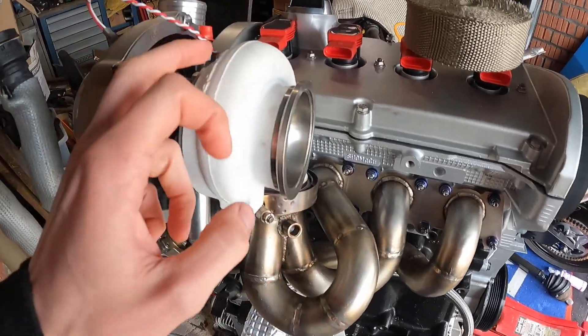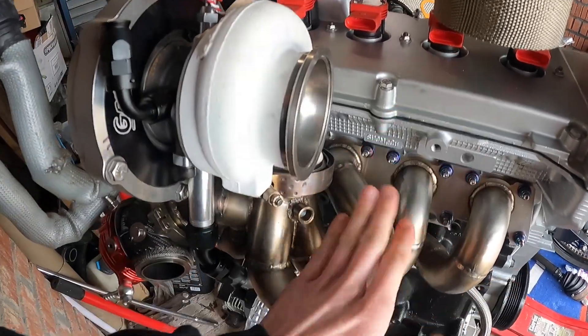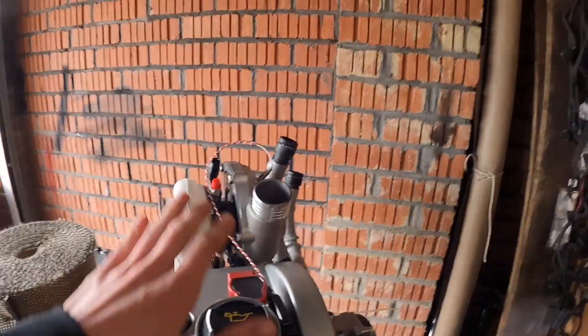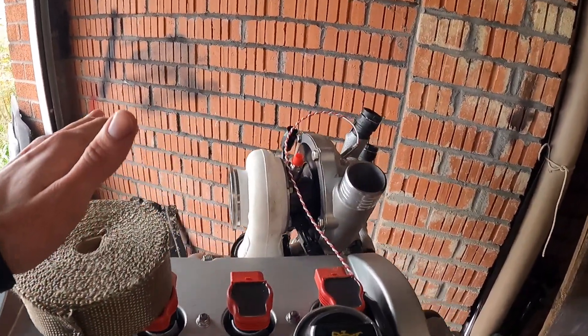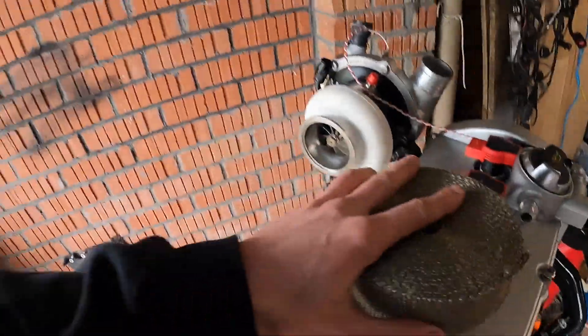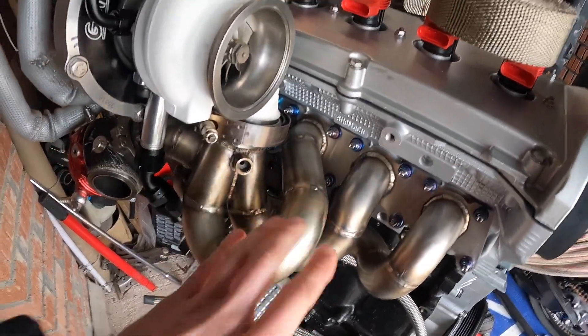I have thought about getting this ceramic coated, the same as this. However, you do not see this - it's in the bay unfortunately, because of my engine. Well, the VW engines - the exhaust is at the back with the turbo. You're going to see this from the front, you'll see the turbo stuck up, but you're not going to see the exhaust manifold. So heat wrap is a lot cheaper than the ceramic coating, so that's what I'm going to do.